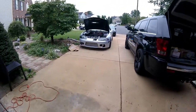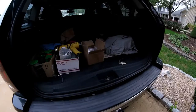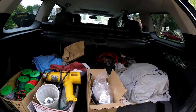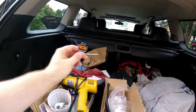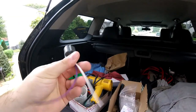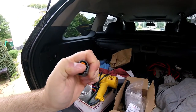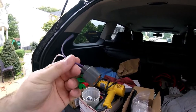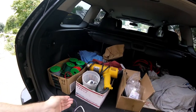One of the things we're gonna be fixing today is my return line from the turbo to the pan - it is leaking. So I went ahead and bought one of these return line kits with a bunch of stuff and some bolt grommets. I've also been having an issue with my knock sensor - I keep getting a phantom knock. I replaced the knock sensor with an Evo 8 one, didn't really change much. I looked at the connector on the harness side and it kind of looked a little burnt up on one of the pins, so I'm going to either butt connect or solder this in.